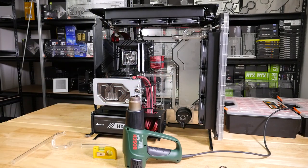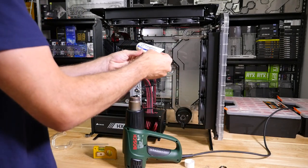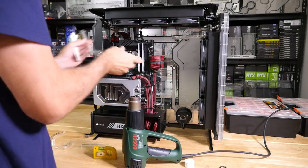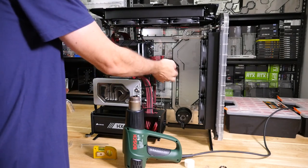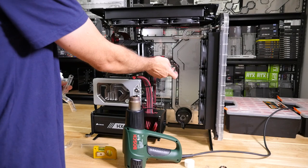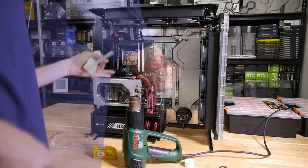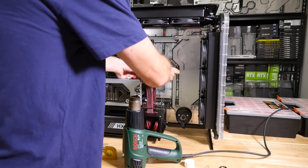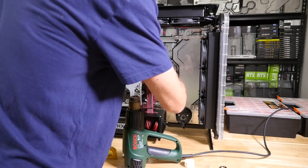Something else important I should mention: I use O-ring grease — food grade O-ring grease. You should use food grade if you can, because you don't know what all of these O-rings are made out of. Usually it's just Buna, but it can be silicone. Make sure to spread it evenly. You don't want to clump it up inside of the loop where the coolant's going to be running, because that's going to mix in with the coolant and end up somewhere in the loop. This will help the O-rings to seal but also make it a lot easier to install. Because you don't want to be forcing it — you can actually slice these O-rings very easily with the ends of the tube, even if you have a chamfer.